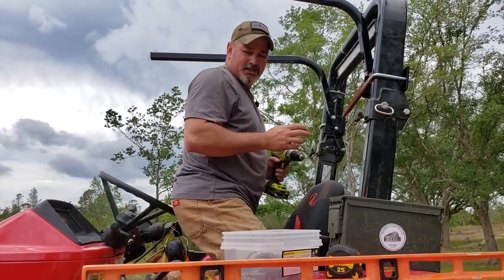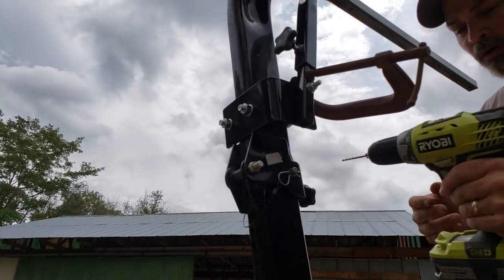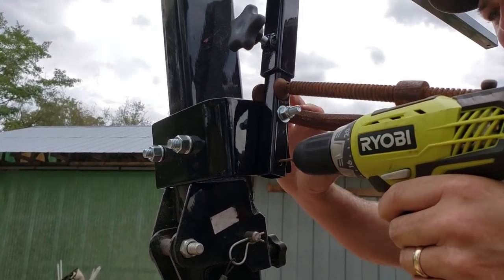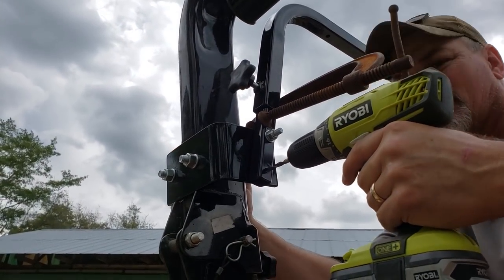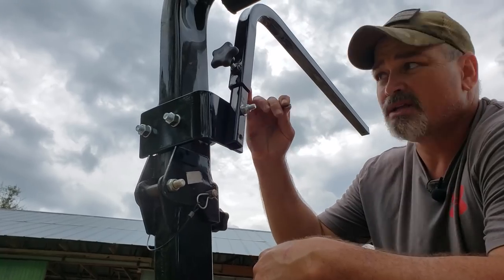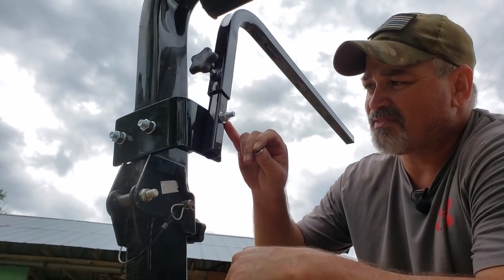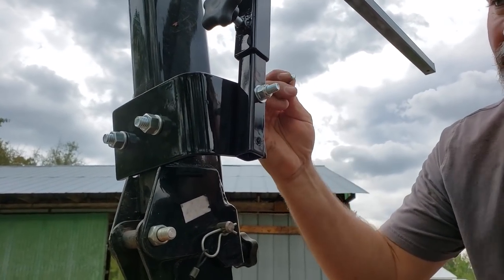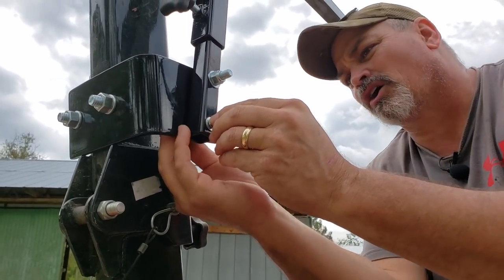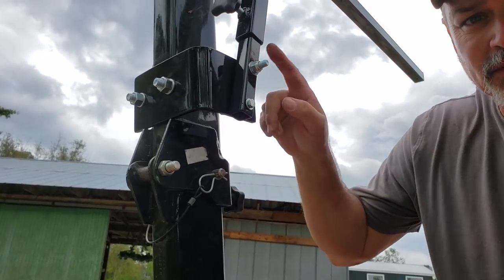Don, when he ships out his instructions and the six easy steps, recommends that you put a C-clamp here when you drill the hole on the bottom. I start with a pilot hole before I do the quarter inch hole. Got my pilot hole drilled, now I get the quarter inch hole for the bolt. So far we've used a three quarter inch socket for our U-bolts, a nine sixteenths for our bracket struts, and now we need a seven sixteenths for the final bolts that go on the brackets. I'm going to turn the nut around and put it on the inside of the ear so clothing or a strap from a ball cap doesn't get caught.